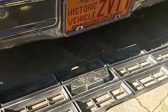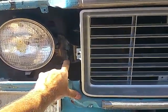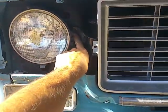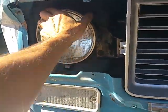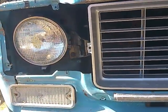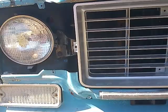It's really quite an easy process. You pull out the C10 grille — bunch of screws around it — and replace the center support and the two sides; there's one on each side. I did have to pull the headlight bezel to get access, but I didn't even have to pull the headlight to make it happen. This headlight on the broken side wiggles around a bit, and the other one happened to not have that ear by it, so it just went right in. The whole job, never having done it before, was probably less than an hour.